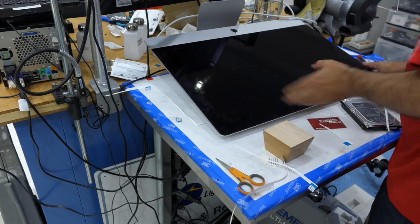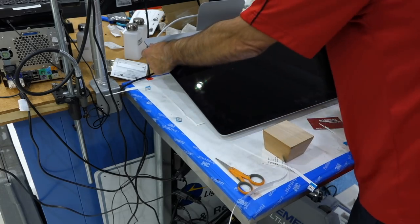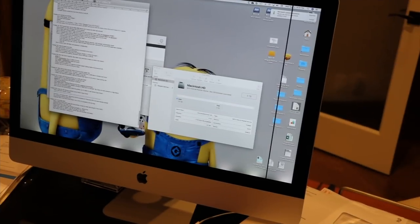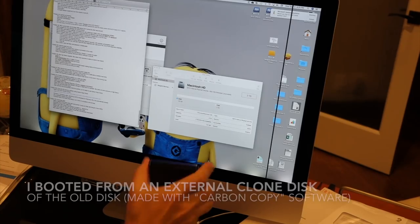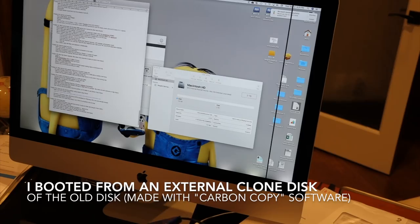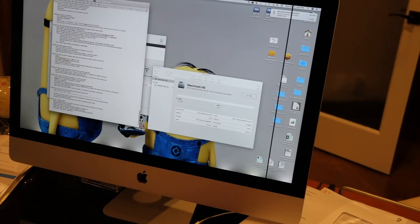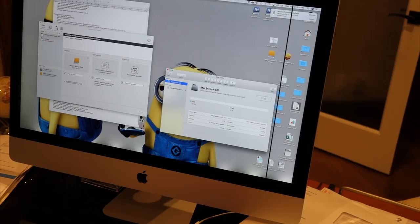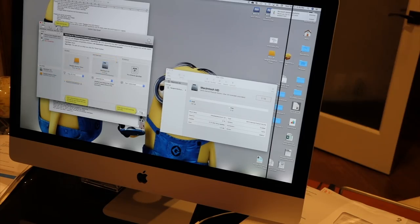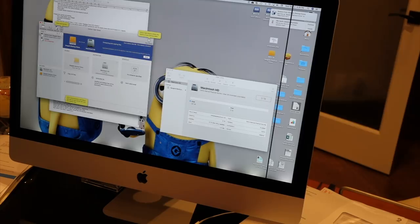Close the darn thing — and we have a semi-repaired Mac. The Mac powered back up. I put it on the carbon copy clone I had made for my desk USB, one terabyte, and it booted fine. Cloning over to the new hard disk. And if it doesn't die during the clone process, that's already a good sign, because before the power supply would give up.